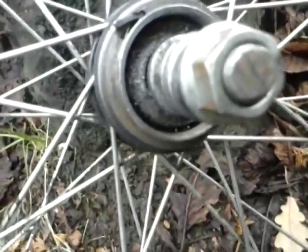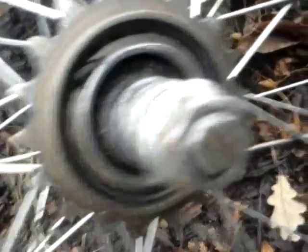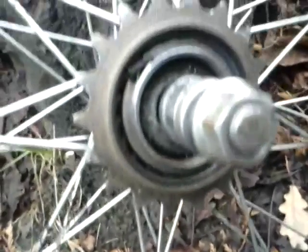What we do is put it back on and just pour one half in. Put this back on with the two little rings, pour the bearings back in over this bowl. Once they're on one side, pour them back in on the second side and you won't lose your freewheel. Alternatively, you can just smash them up and throw them away, but sometimes they're useful to keep.